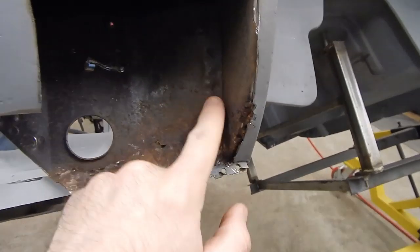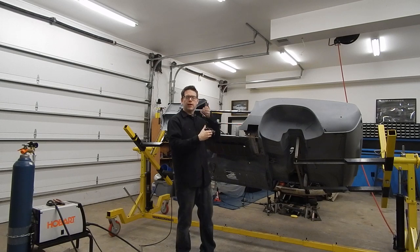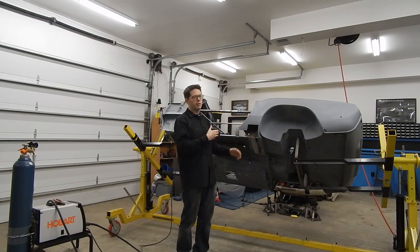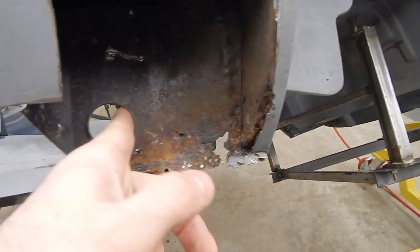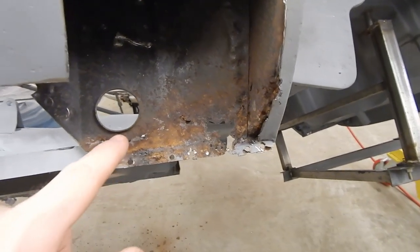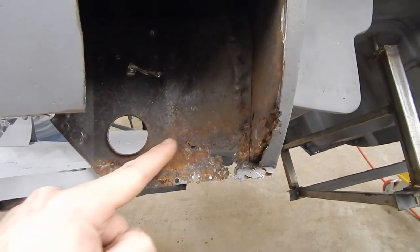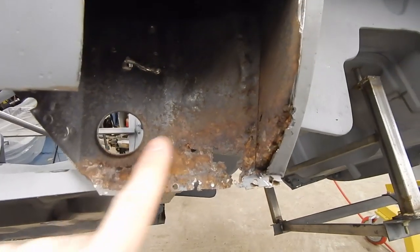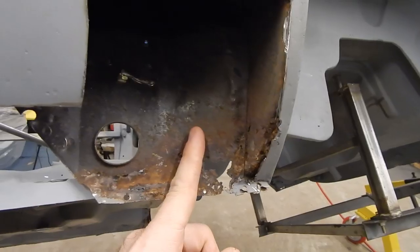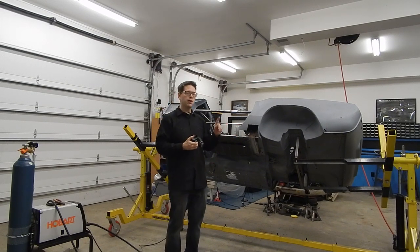As you can see I've cut away the outer piece. What I need to do is repair this before I move forward. Typical to what we've been doing on everything else - I've got to take a little bit of my nice new sheet metal, cut out a replacement part and go ahead and seam weld it in. It does have this hole that's pressed in it and I don't really want to have to mess with remaking this. I'm probably going to just trim out here and angle up and over - it's a fairly simple angle so this should be a pretty straight piece with maybe a bit of a diagonal bend, which I can do with my brake. I'm going to mark this, cut that out and go ahead and replace that piece.